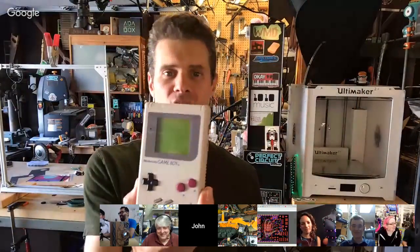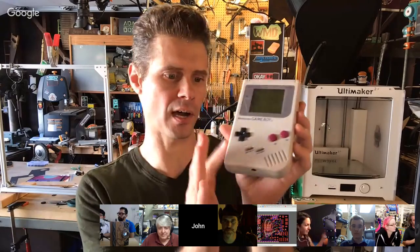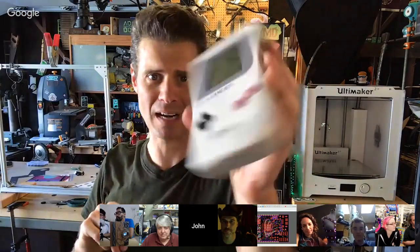And leave this in the sun. I took it all apart first, but the case part's in the sun for about 12 hours total inside of Saran wrap so it doesn't dry out. It sort of finishes that process and it detaches the bromine from the ABS plastic and it leaves the surface and we get back to the original color. At least that's the chemistry. It looks great.